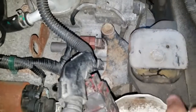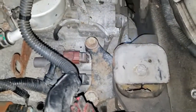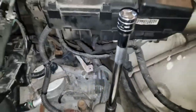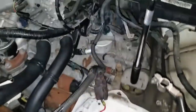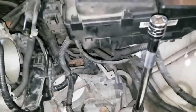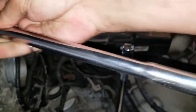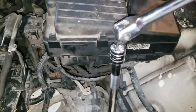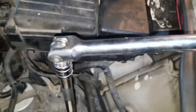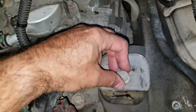The mount is basically this piece here, and to get to it we're going to remove this bolt. That's a 14mm — I'm just going to use my 2-foot pry bar to remove that. I've got my 2-foot pry bar here, which gives nice torque, and I'm just going to break that bolt out. Once loose, I'll take it out with either the air gun or my ratchet. I loosened it with my pry bar and then took it out with my air gun.